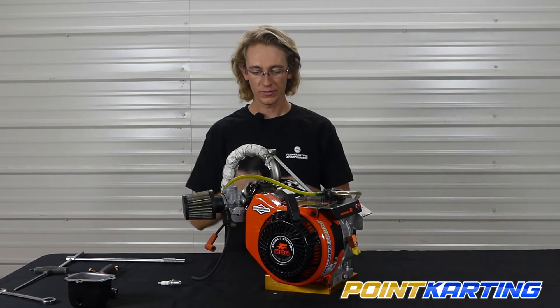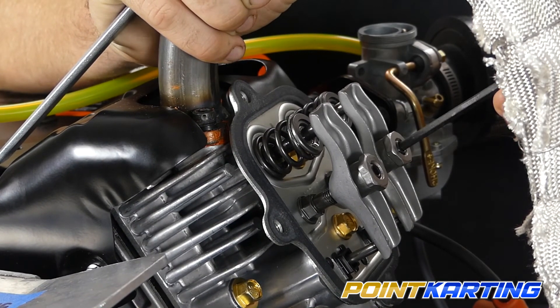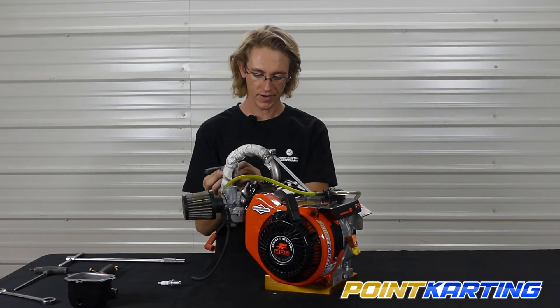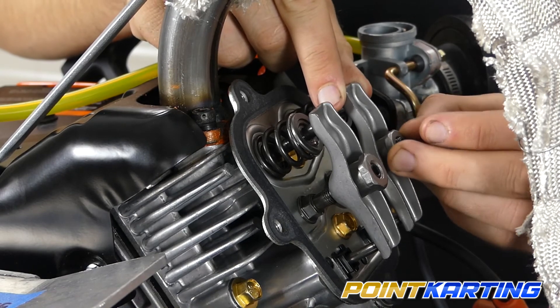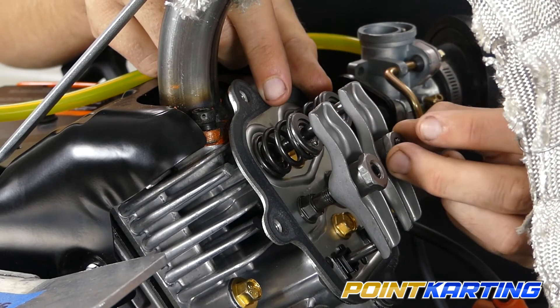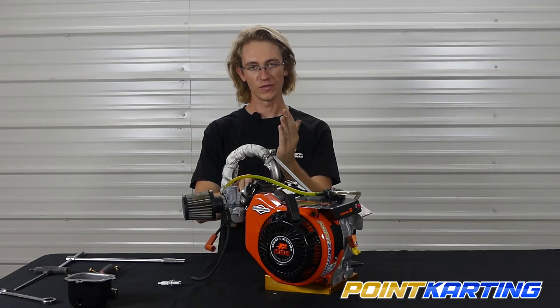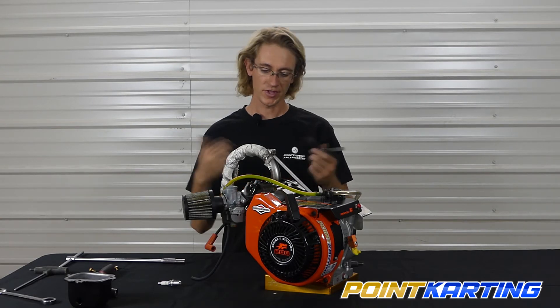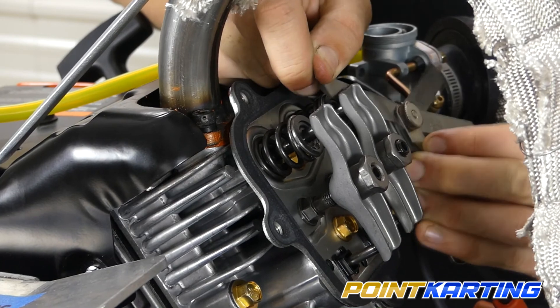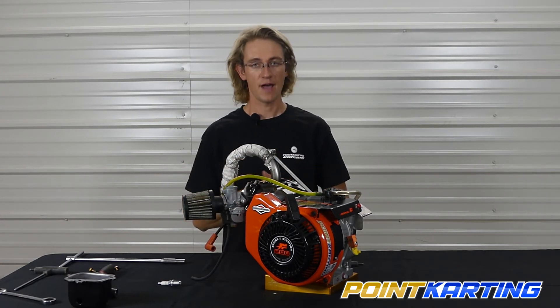To adjust that, take a 4mm Allen wrench, place it in the adjuster screw, and break it loose. Once it's loose, back it out several turns so it's not interfering with our fine adjustment. Back your adjuster screw out and you'll notice the play increases substantially on your rocker arm. To readjust, simply turn the adjuster screw back in until you can feel lateral play side to side but very little vertical play — meaning the rocker arm doesn't move up or down relative to the valve stem. Bring your feeler gauge back and insert it between the rocker arm and the exhaust valve stem. I can feel significant resistance now, so I'm pretty happy with my valve lash after making that adjustment.